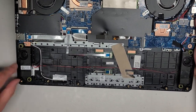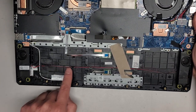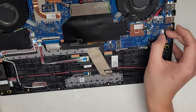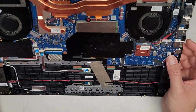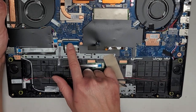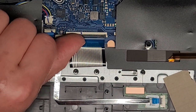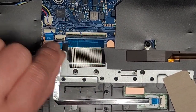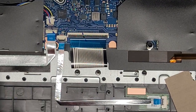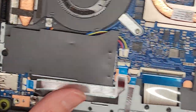There are speakers here — one is here, just held in with rubber things, and you can actually lift it out. This wire runs along to the other speaker and they both plug in right there. That connector has wings — grab and wiggle to pull it out. There's a little heat spreader here, and you've got the keyboard connector. To remove these connectors, there are latches — you flip it up and then you can pull it out. There's also the touchpad connector and the USB port connector on this side.